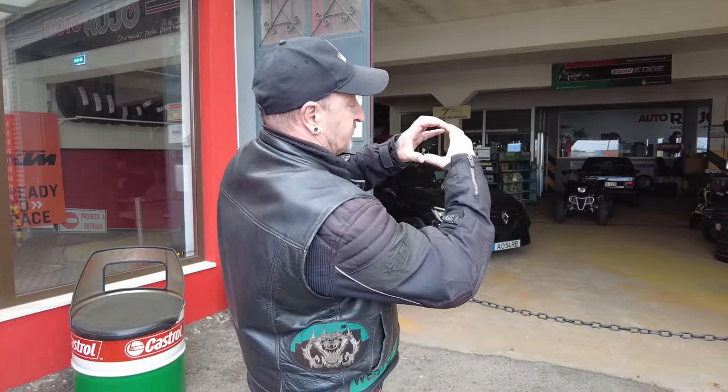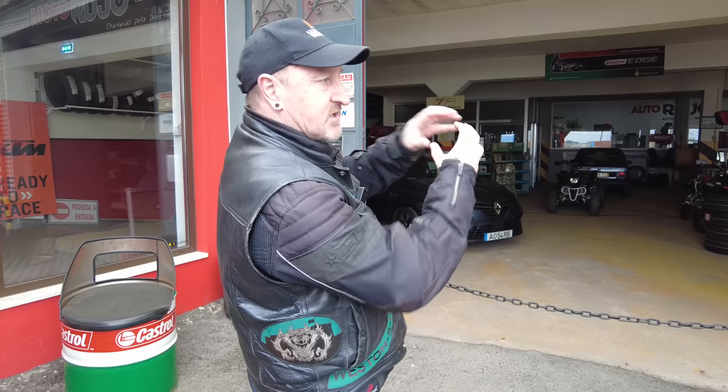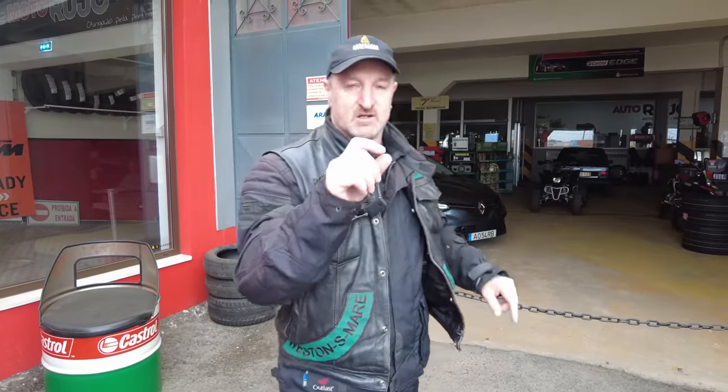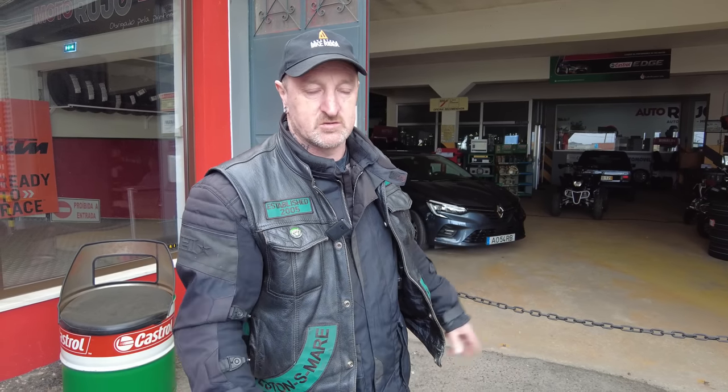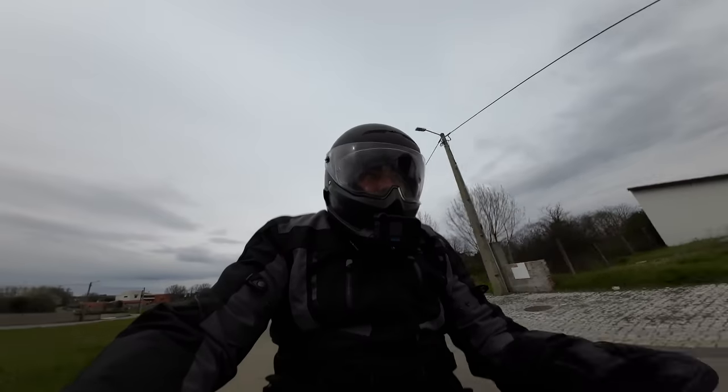We're going to go back to Dave's shop. He's not called Dave, but he is now. I want to take the cover off, because even though we haven't got a puller to take the flywheel off, the flywheel sits like that and the tensioner is behind the flywheel. So you can't do the job without taking the flywheel off. But I just want to take the casing off and have a look, so that we know 100% that it is that little thing. Because if we book it in for them to do this job and it turns out it isn't that, then we've got more issues. So the plan now is to go back to the garage I went to before, so Lee can take it off just to check that that's the right part.